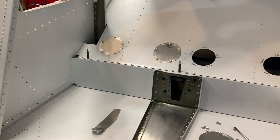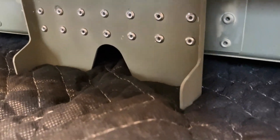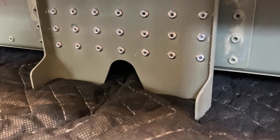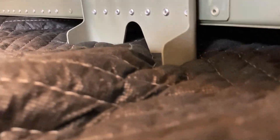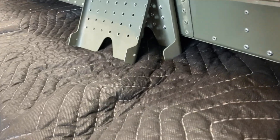The other thing I did today was replace that bracket I had on there. If you saw in my old videos, I had a pre-drilled hole that I didn't like. I want to put it all together, and the nice part is I didn't even ask for it - they just did it. If you can see that, the bottom tab is 10 millimeters wider than the original. There's the original, and you can see that bottom is much longer. It doesn't get in the way of the build at all; it just gives it more edge distance. So I'm glad they sent me one - I didn't request that. I just didn't like being so close on that rivet radius.